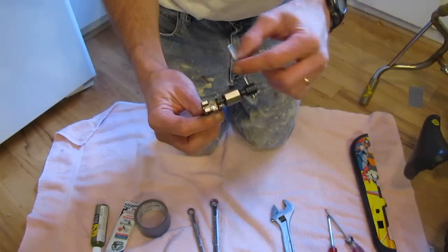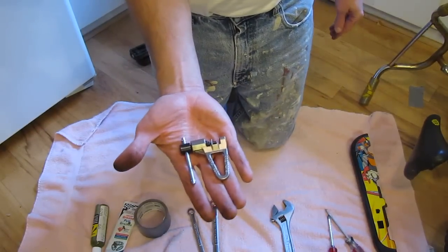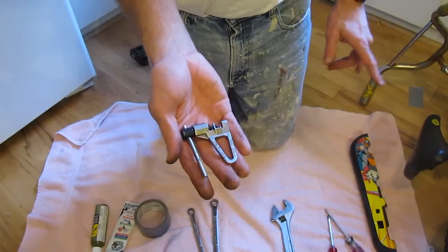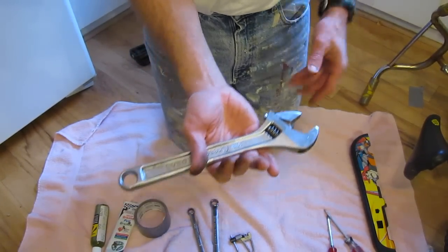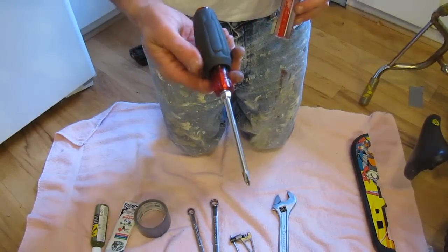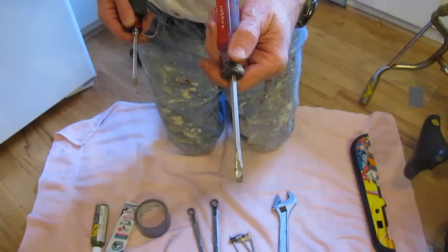The chain removal tool works as a simple vise that presses the pin out of the chain link, and can be turned around to press it back in when you're done. I've actually done it with this chain, and because I work on bikes a lot and have six kids, I have one of these tools — they're super handy, but you don't need it for this particular conversion; it's an option. You'll also need a large crescent wrench with a long handle for lots of leverage — you may need that for removing the cranks. And two types of screwdrivers: a regular flat-head and a number two Phillips head, used for removing the chain guard, which I've already done on this bike.